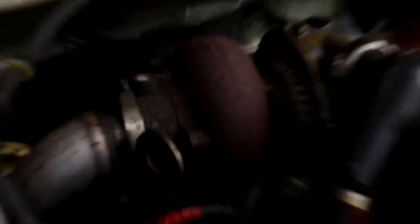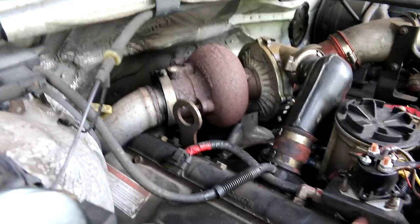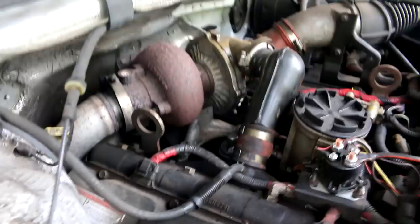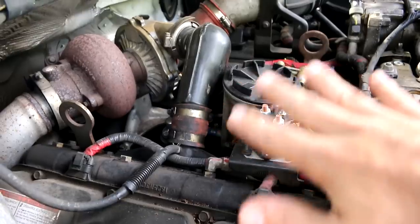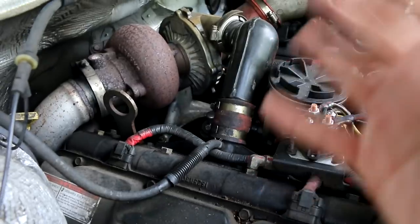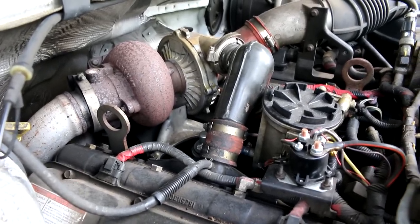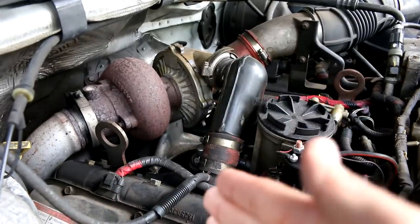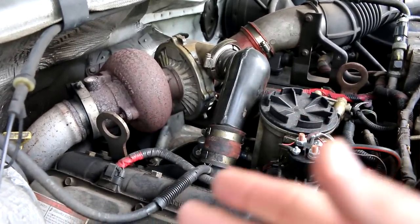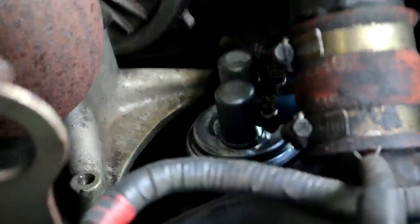Nestled right under the turbo is the fuel pump — it's a mechanical fuel pump run off the camshaft. It is a bear to get to; you have to take off everything up here. I personally left the turbo in place and worked underneath it. It's not too hard of a fix, but you do have to make a modified tool. I think it's a 1¼-inch open and box wrench that you need to bend about 20 to 30 degrees on the handle — heat it up and bend it in a vise. That will let you get the nut completely tightened down there.